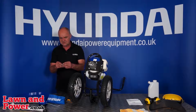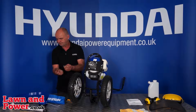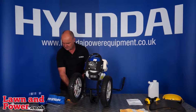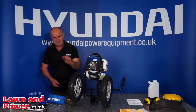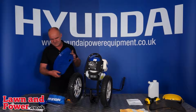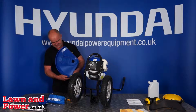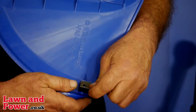All you'll have left then is 2 medium length screws and 2 nuts. These are for fitting the cutting or trimming blade to the guard itself, and we'll do that first. So, again in the toolkit is your trimming blade. This goes on the underside of the guard, and as you can see, the L shape or the high part is the outside, as opposed to this, which would be wrong. The outside is correct.